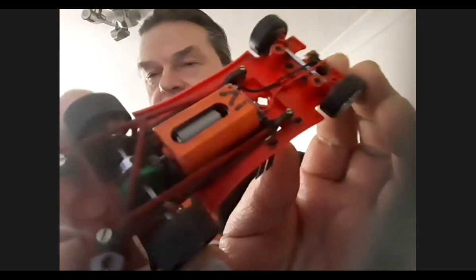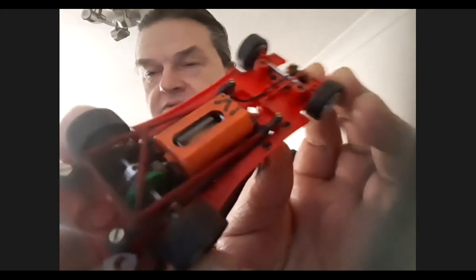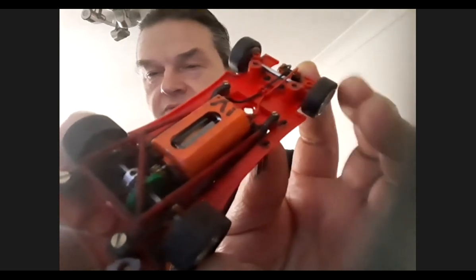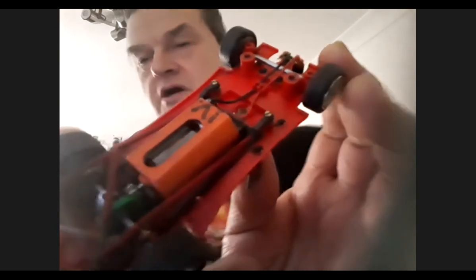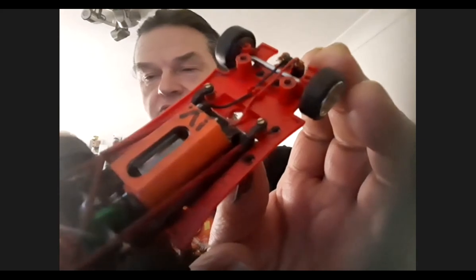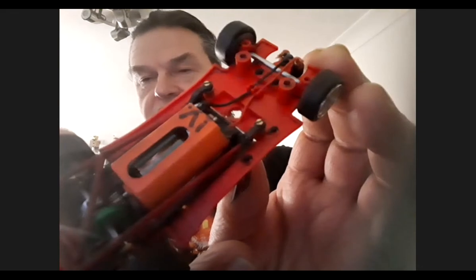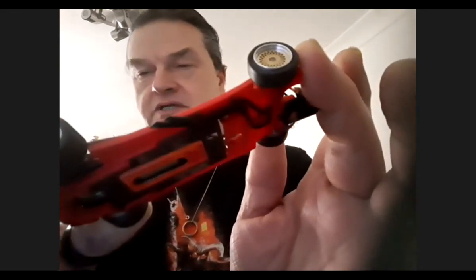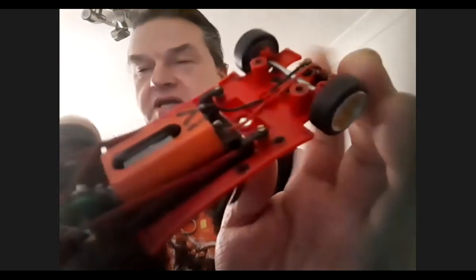So you stiffen the pod, basically. Yeah. The whole thing. I have that same car. Thanks, Alan. Yeah, it absolutely transformed the car. Plus gluing the motor in. This is an Avant Hurricane motor, which is meant to be an angle winder motor, so it's got quite a short shaft on it. But it's glued in as well as screwed in and dropped slightly. You could probably see the slight drop. Looks maybe like half a mil at least. Yeah, I'm very keen on doing that when I can.